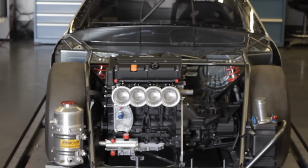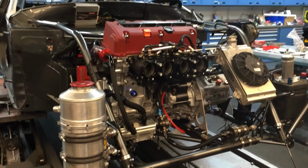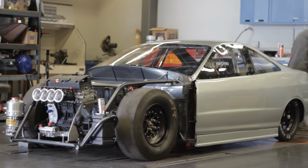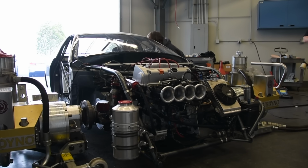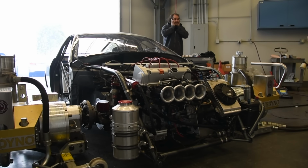I think it'd be interesting, since he's talking about that stuff, to actually tell him, because his information on the Honda Pro Stock stuff is a bit skewed. I don't know where he's getting his information from. But if we gave him the real data, and I also wanted to flow test some throttle bodies to see if they fell within his theory. And if they don't, then the discussion would be, how do we harmonize the theory with the empirical observation? Ultimately the theory is great, but over the years I've really just become, you've got to test it. You pick a starting point and keep bracketing and moving in a direction until you hit it. You're basically solving chokes, uncorking chokes.